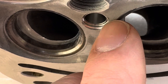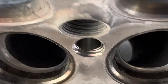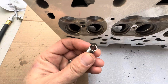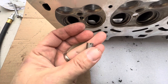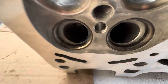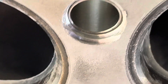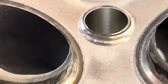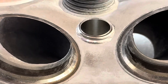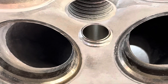That little bit of metal could break off inside the engine, but even if it doesn't, it becomes a hot spot — and that leads to the second issue. The injector bore insert is screwed in from the top. At the bottom of it, you can see sharp edges where the tap has cut threads, just on the bottom edge there. All those sharp edges, as well as that metal flake I pointed out, are all sources of pre-ignition.